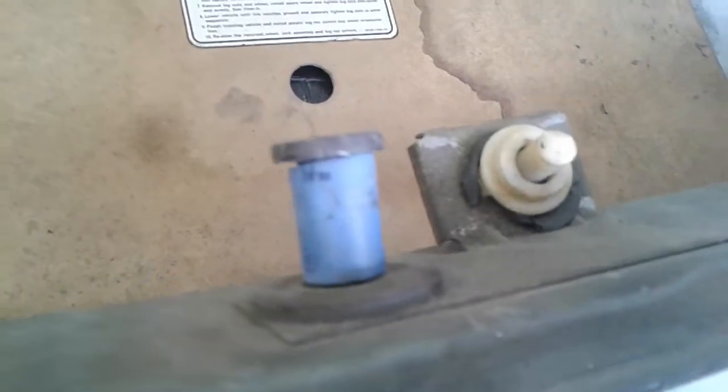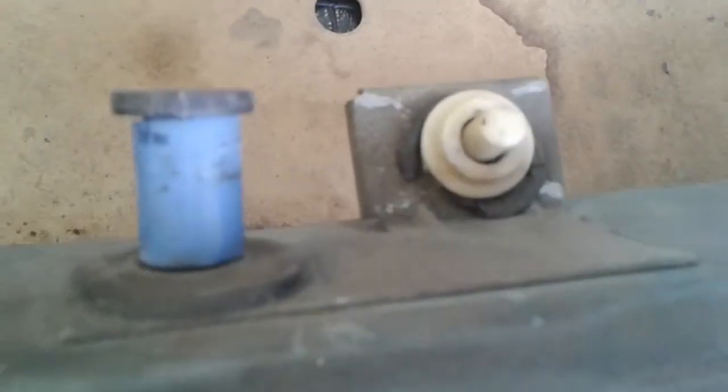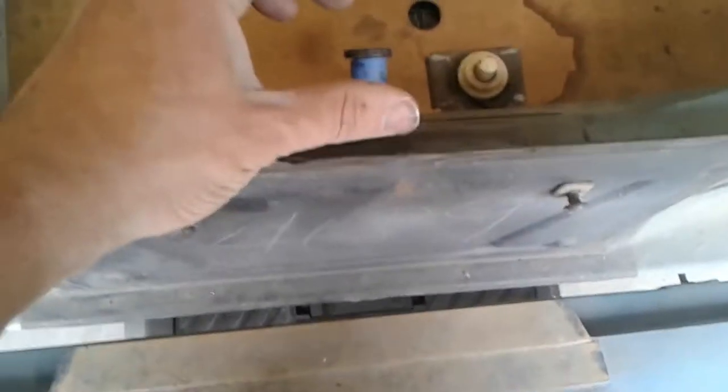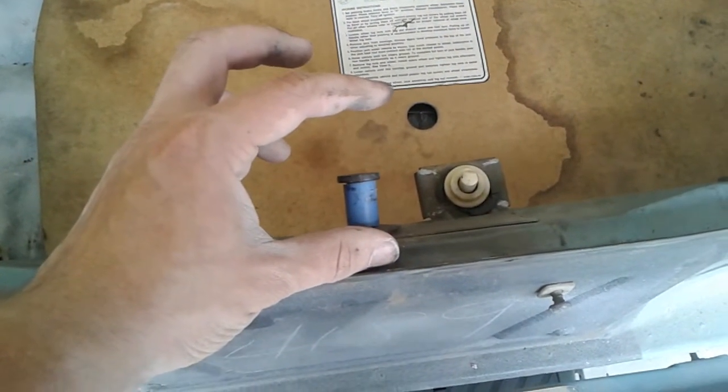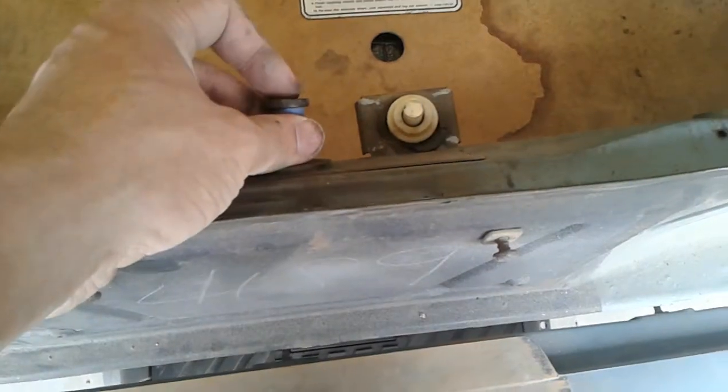I put my own — I think it's nylon of some sort. What this is is like a sort of PEX — like a blue PEX for water lines, liquid lines — and I think this one is for a semi truck or something. Anyway, it comes in long tubes, usually coiled up in long sections. What you need to do is cut off a section about this long so you have something to hold on to, because you need to bore out the center.